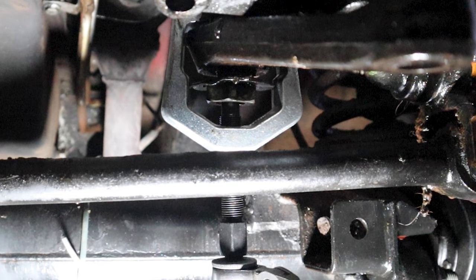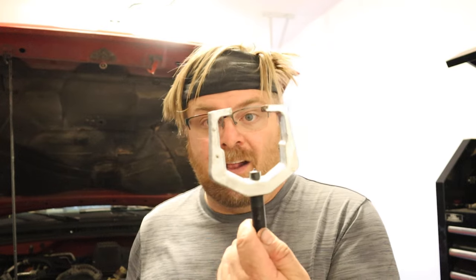That was until I encountered the bane of Land Rover's steering box replacement — pulling the Pitman arm. When your puller starts looking like the wishbone on Thanksgiving Day, it's best to stop before it comes apart. So I got them out. I got the new one with me and the old one in a box. I'm going to take them around the corner to an auto shop and try to get them to press that Pitman arm off. I tried to do it myself and all I ended up doing was bending the tool. It wasn't budging, so it's time to try something different.